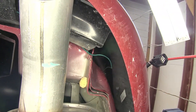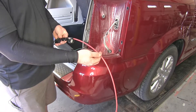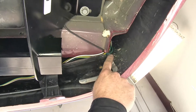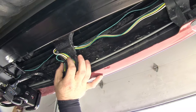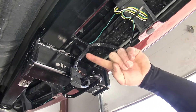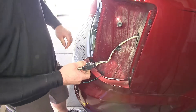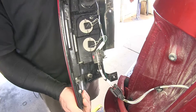I used a fish wire to pull the connector up through the opening to the passenger side tail light. I used an old piece of airline tubing, though a coat hanger works too — something stiffer that can help pull it through. I taped the connector to the end of it. The four-pole wiring was routed along the same path as the green T-connector wire. We bundled up the extra wire, zip-tied it, and brought it down to the hitch, adding a bit of black electrical tape at the end for a cleaner look. Then we made our connections behind the passenger side tail light and reinstalled it.